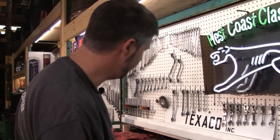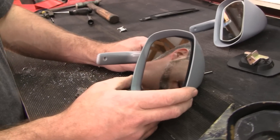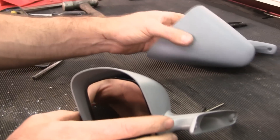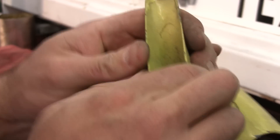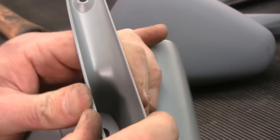We also have the complete mirrors reproduction. The way you can tell they're reproduction is they're nicer than original. Look how thick the metal is all around there. Look how thin the metal is on this NOS one — look at all these goofy, uneven grinding lines on it. It just looks unfinished. Now look at the reproduction — nice, smooth, finished. On the originals, NOS or otherwise, look how thin that metal is — these bend easy, the metal is soft. If I wanted to, I could just crush that in with my thumbs. Take the reproduction — you've got thicker metal and you can't bend it in with your thumbs.